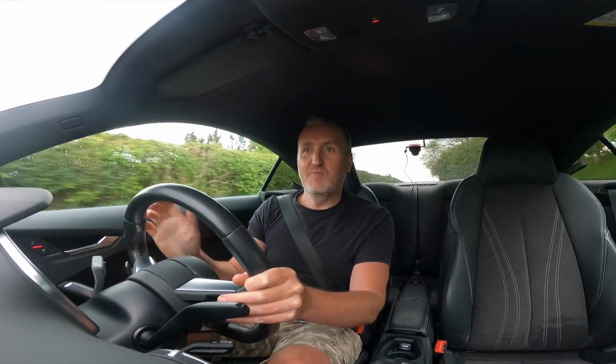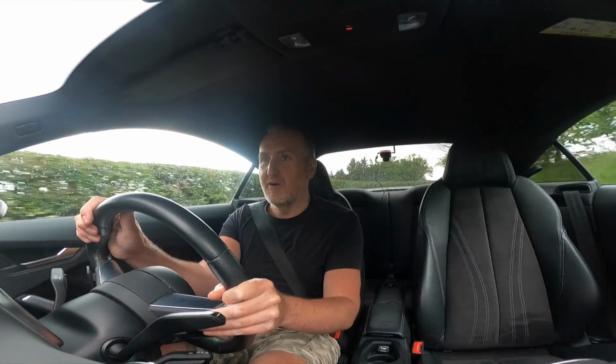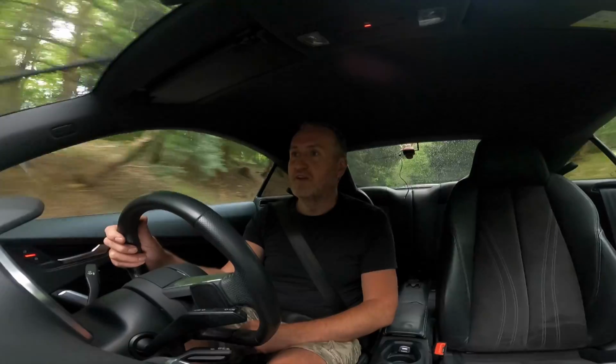And obviously with extra mods, it's going to make a difference to the horsepower and everything else. You need the high flow filter. Basically, what we've done here is increase the airflow into the turbo and into the engine. We haven't increased what's going out, so we're still going to be restricted by cats and God knows what else they put on these days. So that would be the next thing to do, to really open this up.